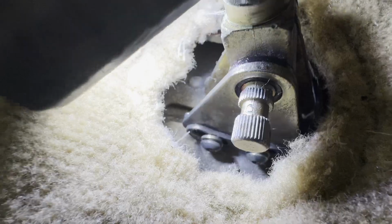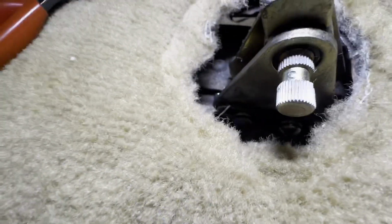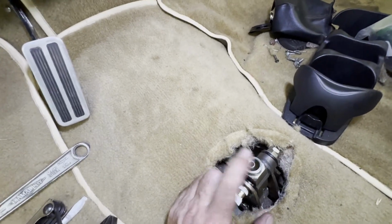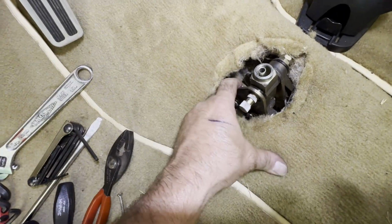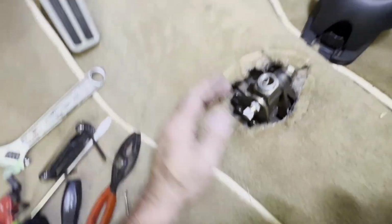Okay, so we got the 2 bolts in on both sides. Had to crawl underneath of it to do this back side. They're loose right at the moment. So what we're going to do now is put the stick and inner cable in it and then adjust this. It's tight right now, but we'll adjust this to give us the clearance we should need.